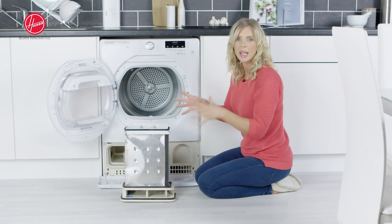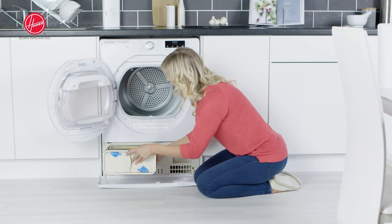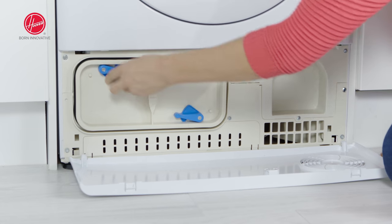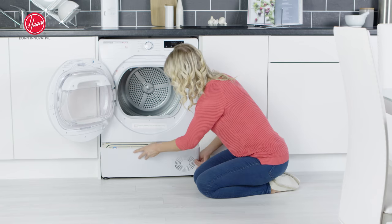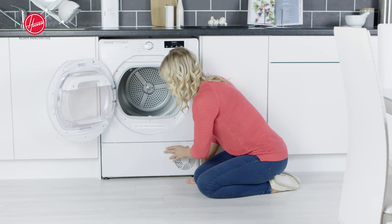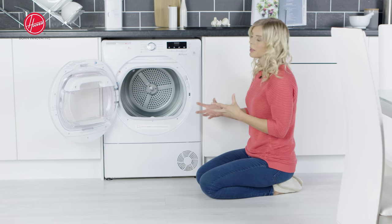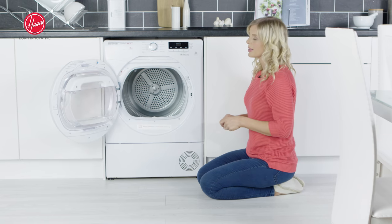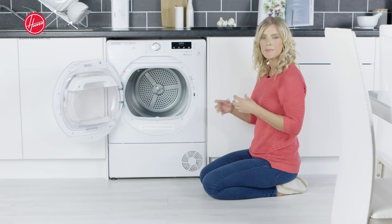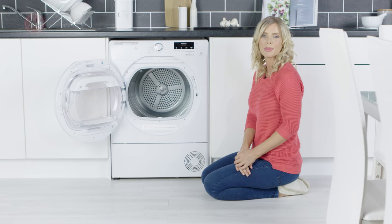You are able to refit it even if it is still a little wet. To do so, just place it back where it came from, put those toggles back to lock the condenser in place, and then replace the bottom of the tumble dryer. Remember, effective cleaning of the appliance is beneficial to the efficiency of the tumble dryer. So there you have a step-by-step guide of how to maintain your condenser tumble dryer, making sure that it's kept in tip-top condition.